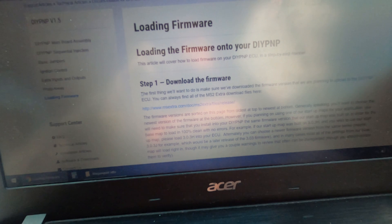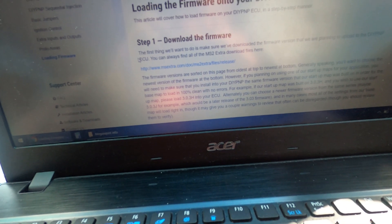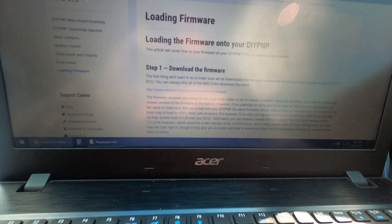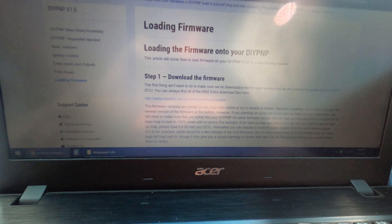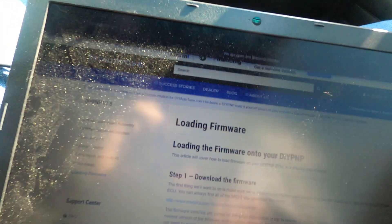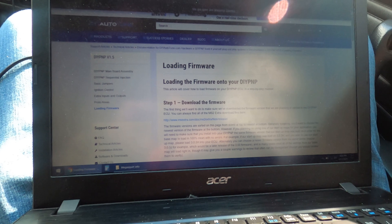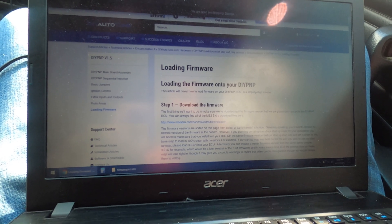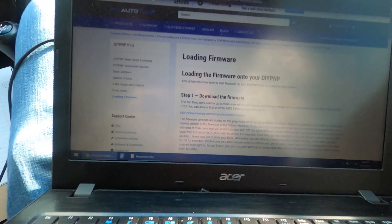What's up YouTube. I've been having some weird issues with my DIY plug-and-play on my E30, so I'm going to reflash the firmware to the latest one and then probably start the map from scratch. I took a bunch of notes on what my settings were to make it run correctly — timing and things like that. I've been using the stock base map spark table so I can just get that no problem, and I had a VE table that I did export just to make my life easier.